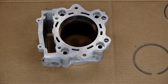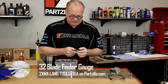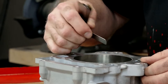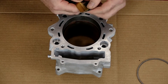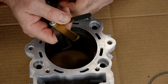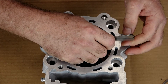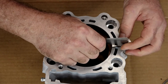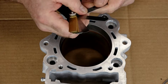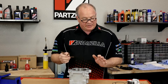We're going to push it down about even with the centerline of the bore for the wrist pin — that's basically got it down in the barrel an inch, inch and a quarter, which should be good enough. We're looking for 16 thousandths. Let's see where we are: 16 is too tight, let's drop down to 11. 11 still goes. 12, 13 but just barely. 14 stops. So it needs to be adjusted, but not much.